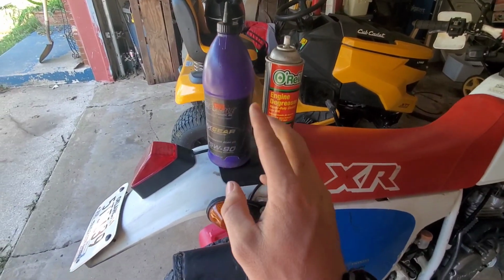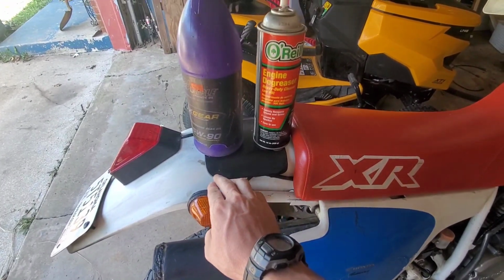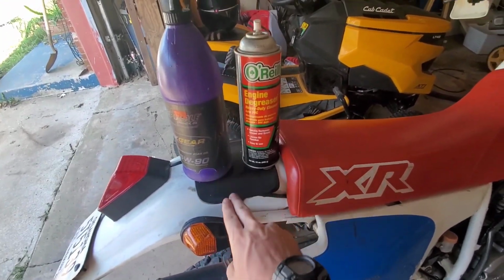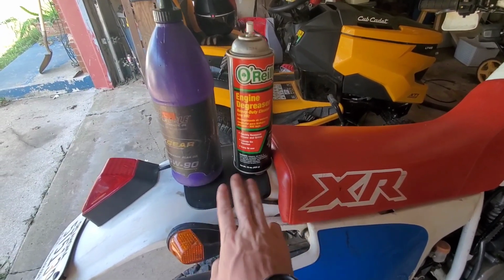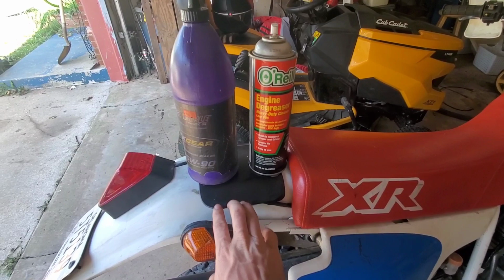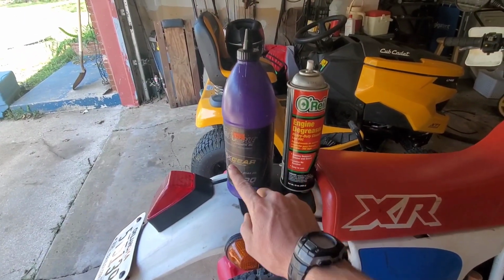But if you want something better than what's available online to buy, and better than this normal gear oil, what you do is you take some of this gear oil, a little bit of a solvent, so I use either alcohol, gasoline, acetone, something like that. It's just a basic non-corrosive solvent, and mix it with this to thin this down.